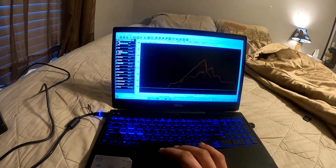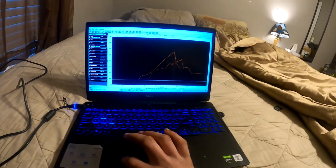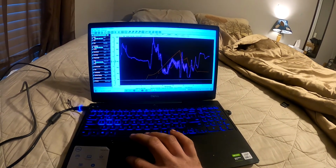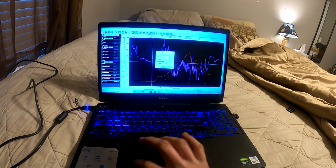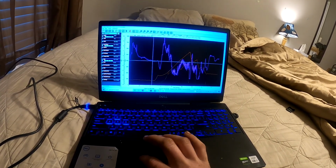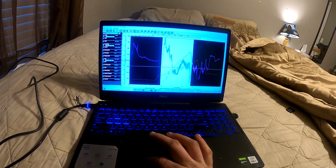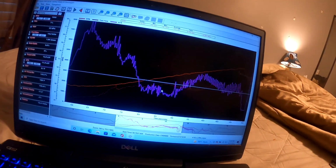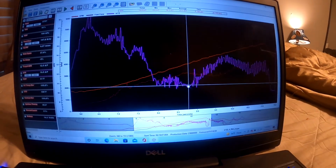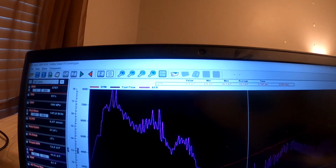But if you go over here and look at the... Sorry, I'm new to this. Where's the actual air-fuel ratio right here? So, you can actually change this to where it will be a lot narrower window. But let's see. We want to look at from here to here, and you can see that my air fuel ratio right here is about 10.5 to 1 on this number here.